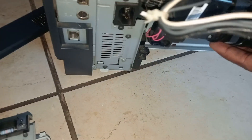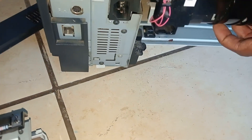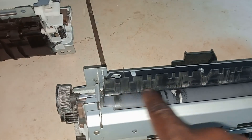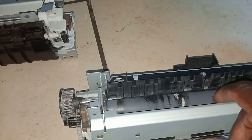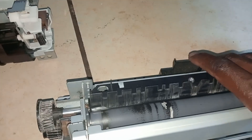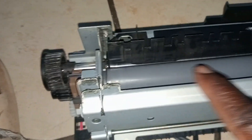So how does it go in? It goes in like this. I brought a new one. This plastic sleeve can be changed, which means we avoid buying the complete fuser unit — they do sell those separately. Now when I show you how this one goes in, you can see it's clean, which means it's going to give good results.